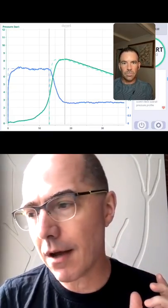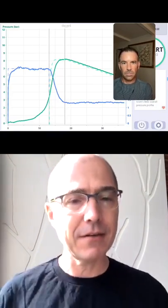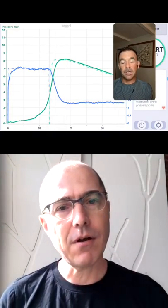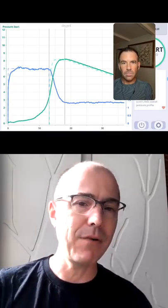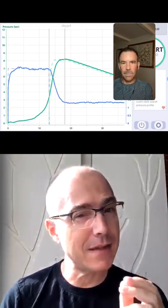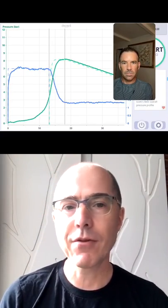Right. So what I've got on my desk right now is a beta version, and I have to integrate it into my software that lets you do flow profiling, but with a pressure ceiling. So what you can do is say, don't go above 9.5 bar, because that's the point at which more flow gives us more pressure, which then decreases flow. I think that this is the secret sauce that will let us do flow profiling.